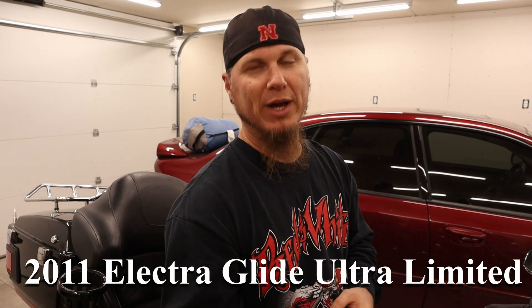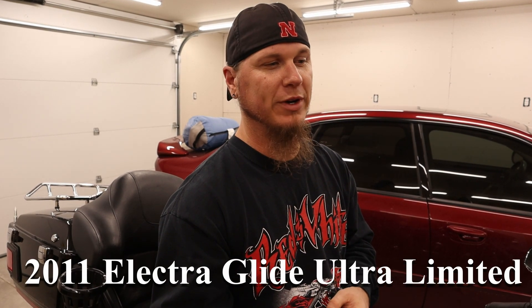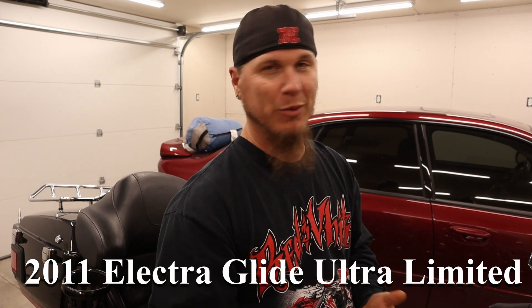What's up guys, real quick — I'm out here doing some maintenance on the bike before we leave for Bring it Home. Last year it was a very slow parade, and a lot of people don't know they have parade mode on their bike. It's actually called the Engine Idle Temperature Management System, or EITMS for short. I'm going to enable mine and show you how to do it, so if we find ourselves going half a mile an hour for an hour, we won't get engine damage.